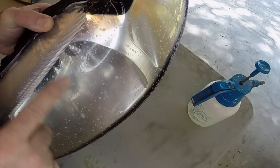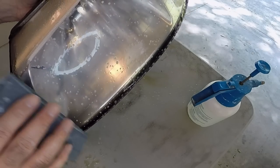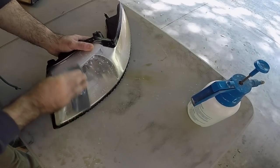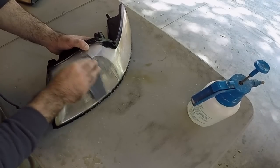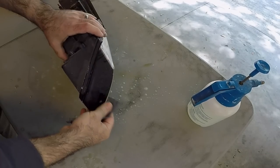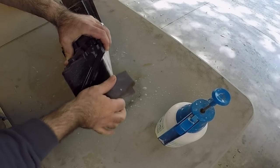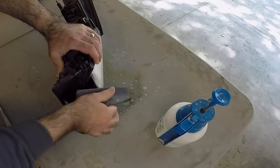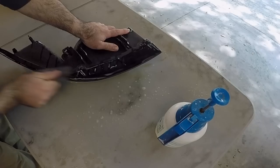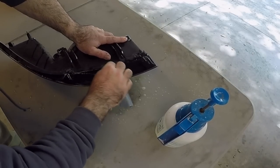There's still a little bit of oxidation but it's actually not that bad — once you buff it out a lot of that's going to come out. Now what we need to do is come back and cross-hatch this thing. Even though we're clear coating, that's how I want to handle it. This is not auto body work so you don't have to worry about being perfect. Since we are clear coating, you have to sand everything — you want to make sure the clear coat adheres and doesn't peel off later. Scotch-Brite would work really well underneath to make sure everything adheres and rough the surface up.